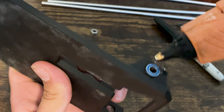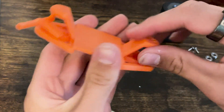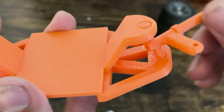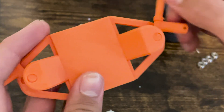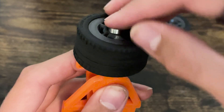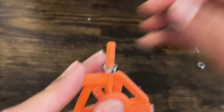To start assembly, I'm going to put some bearings into the car for the rear axle. This piece here is where the front wheel is attached to. I think it's the most interesting piece I made on this car because it was designed to be a print-in-place part. The two rods that the wheels pivot around have ball joints, which allow a varying amount of camber depending on what degree to which the wheels are turned.